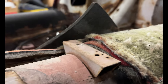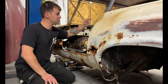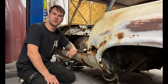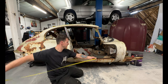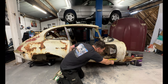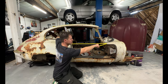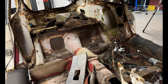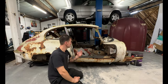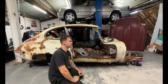The plan for today is to check my measurements across the doors to make sure the car is square, then start welding some bracing in. I'm taking two measurements from the doorway - first across the base of the sill, then I'll check that on the other side and also take a diagonal measurement to check for any closing up. Because this car is very rusty around the sills and floor pan, I want to make sure it hasn't closed up at all - this is the time to correct that easily by jacking it out slightly and welding in structure.